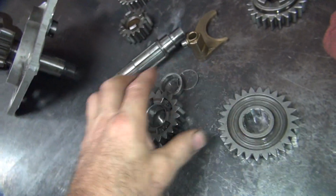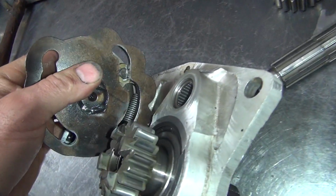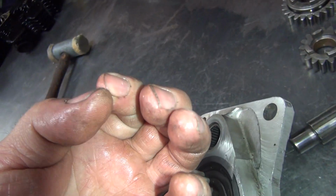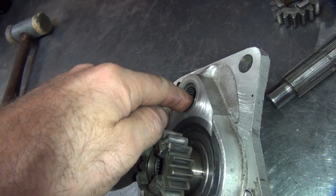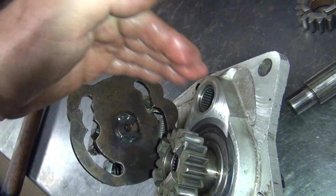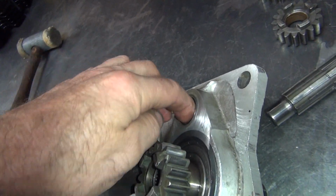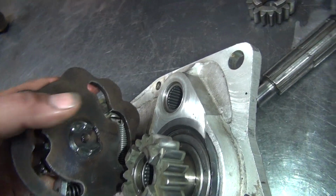That looks pretty good. Between the rollers in here, I stick my fingernail between the rollers. If there's a big gap between them, the bearings are worn out. You also look at how much they lean over. If they lean over quite a bit, they're loose. If they're pretty straight up and down all the time, they're pretty tight. So this feels pretty tight, so they're probably new.